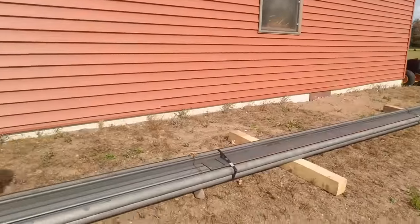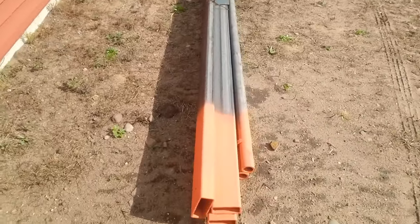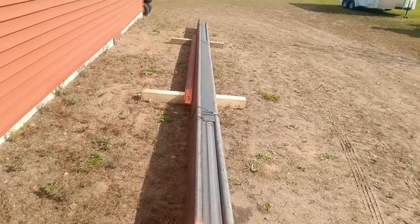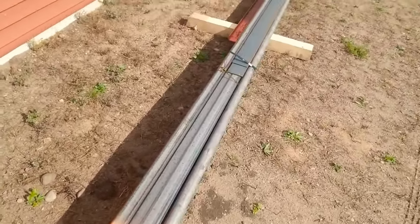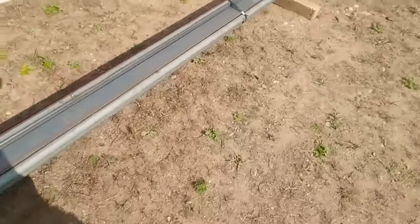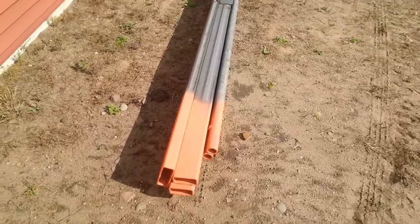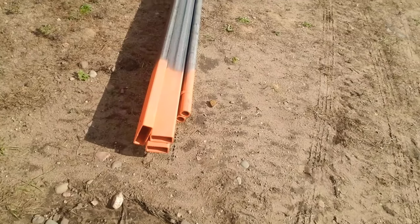Here's the pile — this is the tube I got. You got the 2x4 stuff here, 3/16ths wall, 2x6 here. We've got plenty to work with — these are 24-foot sticks. A lot of extra. We'll be able to make front and rear bumpers, some cross-member stuff. We'll see about exactly where we're going to put the cross-members or what the design's going to be, but we'll worry about getting the frame slapped together first. On the other side, this is 2-inch DOM tube steel for the 4-link and the 3-link. I probably should have gotten one more stick of that.